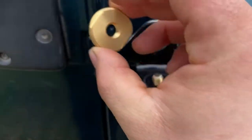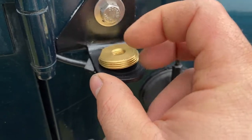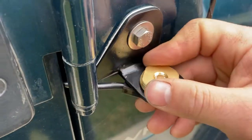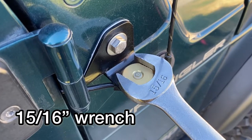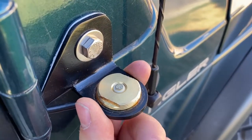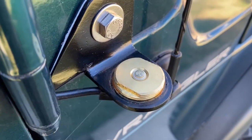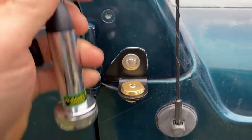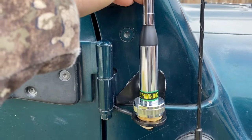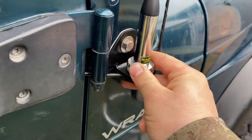The next part is installing this piece — make sure that the rubber O-ring is facing down, then just thread it on. Everything should center up and you can see the cutouts where we can take a wrench and snug it down onto the mount. For those unfamiliar with external mount antennas: the center conductor is your positive and the outer casing is negative. Once snug, install the antenna by threading it in — this completes the NMO mount installation. It just needs to be hand tight.